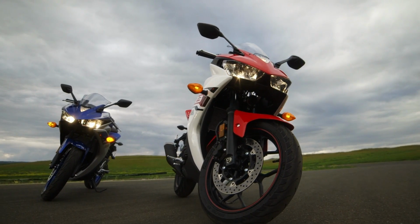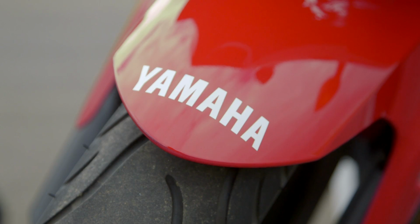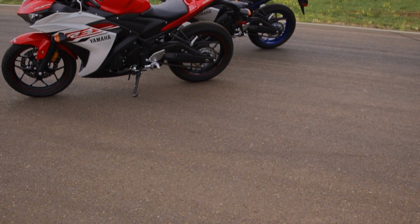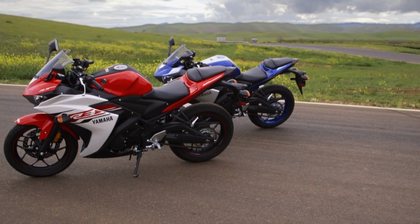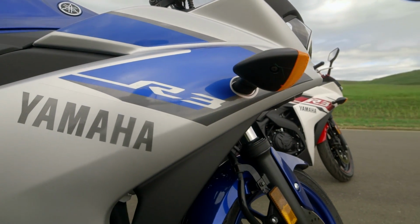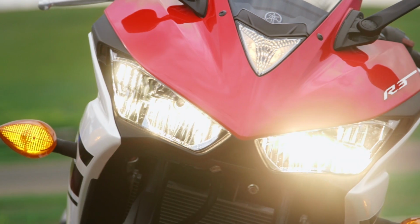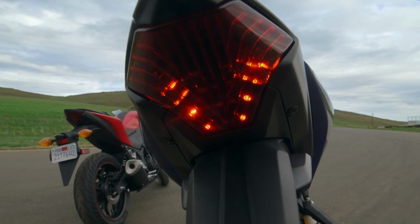The rubber on it is actually a Michelin Pilot street tire that's been specifically designed for this bike. It is a bias ply tire, which is one of the areas I'm definitely curious to get on. Yamaha said that they did it for budget purposes. They wanted to get more life out of those tires. But in my mind, when you have a bike that's this capable of being sporty, there's just no reason not to go with a nicer tire on this.